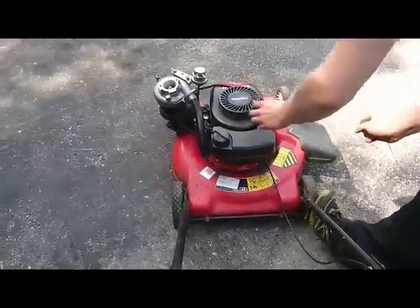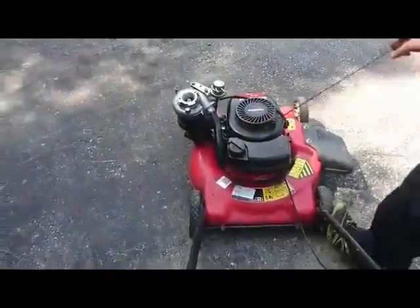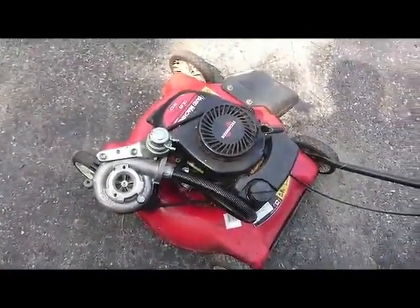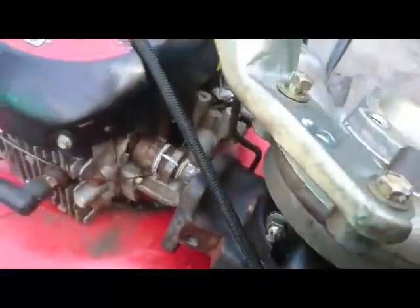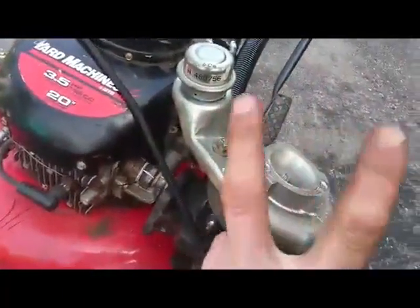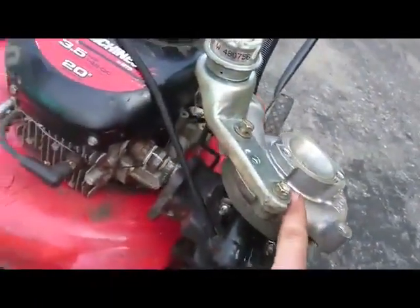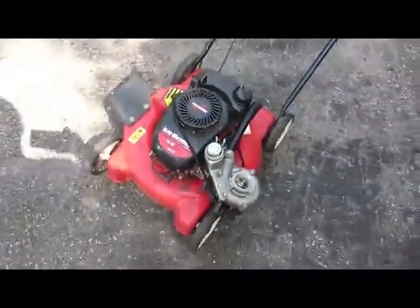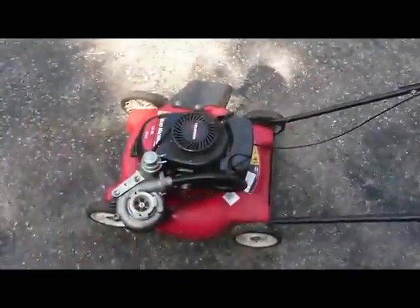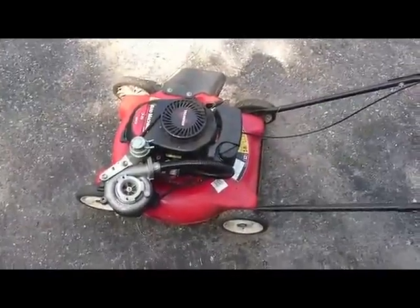Okay, take two — quick prime — here we go. It did run for about a second but not very long. The main reason is probably lack of exhaust, or a major exhaust leak because of my flange setup. The goal this video was to make it work, and although we didn't build any boost, we did make the turbocharger spin and it was mounted for a few seconds, so I'm still going to upload it. Thanks for watching — if you like it please subscribe, let me know if you want to see more, and as always please like, comment, and subscribe.